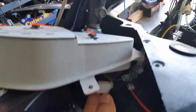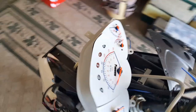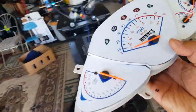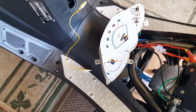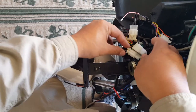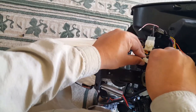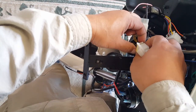That worked! Our odometer reading right now is at 0.000 — like we never even started the scooter. Let's also check the old gauge cluster. Let's try to see if this gauge cluster is going to work the same route. Disconnect this guy here. We fired it up and the RPM worked right away. So our RPM is probably sitting at about 500 RPM. Now I'm going to grab it up to 3,000 RPM. Now it's kind of like not working — it's an intermittent issue. Let me see: I'll disconnect him and plug him back in. Look at that — there we go. I plugged him back and gave it throttle. It's just an intermittent issue, probably with the connection and the wires.